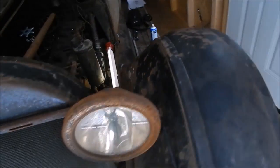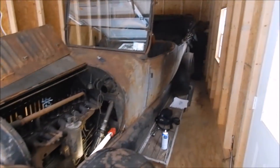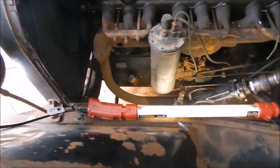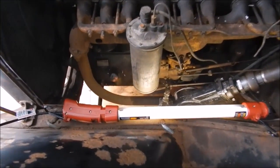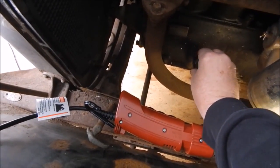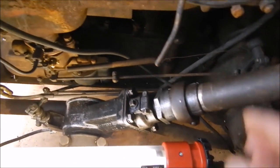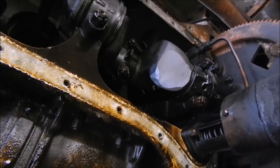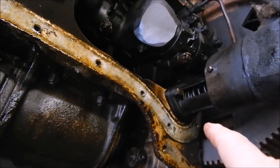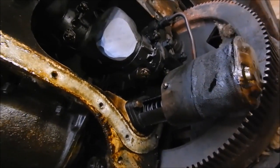Here's the car — just got glass and a windshield a few months ago. This is the side that the oil gauge goes on. This is the oil filler spout, obviously in the front. Oil goes in the front, goes down through one flapper valve, down through the other flapper valve, and finally gets to the back where there's another oil filler spout. Here's the underside — you can see where the oil pan goes, that curved part, the oil pump, and the oil pump screen which I'm going to take off and clean.